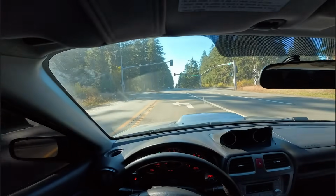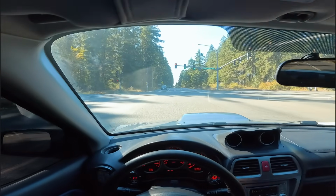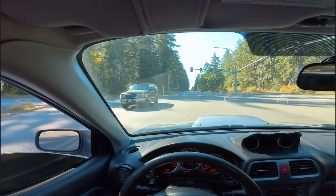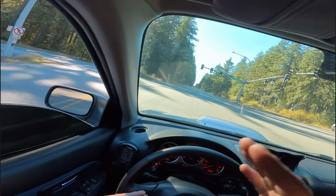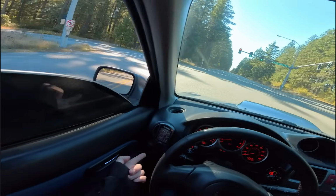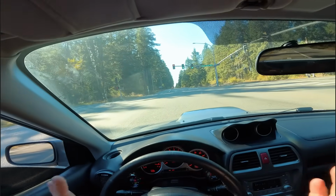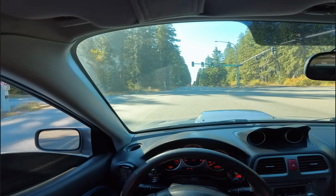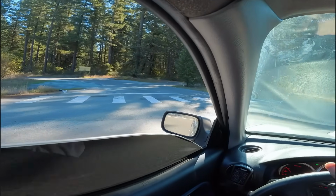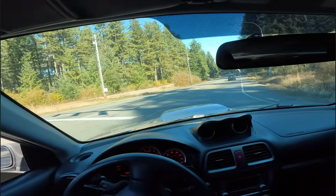That was another one I had to figure out: fuel overrun. That is when your car is coming down in RPM, and if it doesn't catch itself right, it'll want to die, or it'll come down on idle super weird. Yeah, look at idle right now, within 1%. I have spent way too much time making this car idle so well within that range. I just need to turn around. Where can I turn around at?